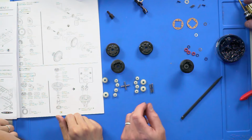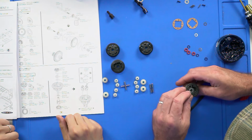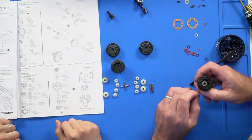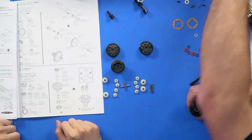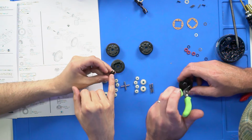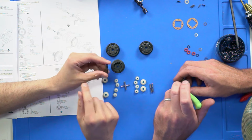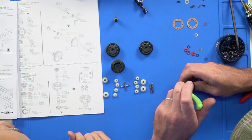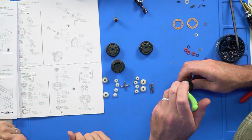Pin through the drive cup. Now, is there a particular method that it's saying to locate the pin? No. So I reckon if you use your needle nose pliers... I'm going to have to, aren't I? Manipulate it. Yep. If we look at this, the lines in the cup for the dog bone are the same as the direction of the pin holes. So if you can feel that through the bottom, you get an indication of where they are. Sort of there. Just a little bit of deli.